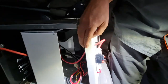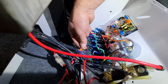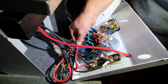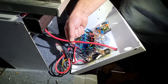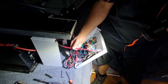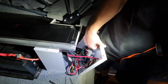We've only got a 50-amp breaker, so we have to take that into consideration when loading up. This is the wire to the fridge running all that way — when we measured the amp draw with the fridge running, it's nearly 8 amps, so you're pulling a lot of power through that little cable. We're going to cut that off and upgrade it. The fridge is pulling 5 amps, that's pulling 4.5 amps off the battery, but it's pulling 7 amps out of the switch — so we know the voltage drop from the switch to the fridge is massive. We're going to upgrade that.